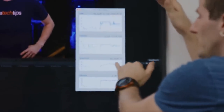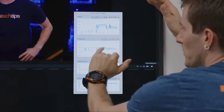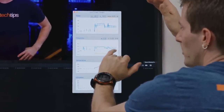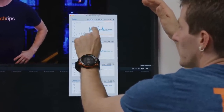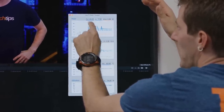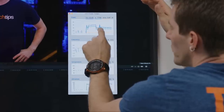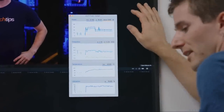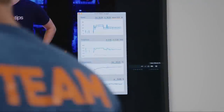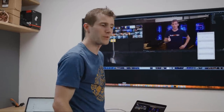We got up to about 90 degrees in a real workload — 88. You can see here where the frequency went from about 3 gigahertz down to as low as 2.35, 2.4, 2.5. And you can see right here where the power for the package went from about 30 watts down to like 20 watts, and then settled in around 20 to 23 watts. Realistic workload — this thing throttles in a matter of less than a minute. Unrealistic workload, it throttles in about 3 to 5 seconds.